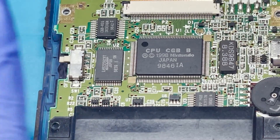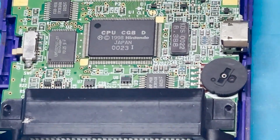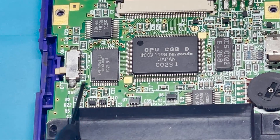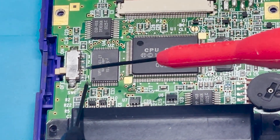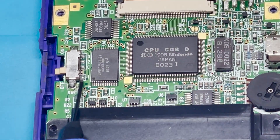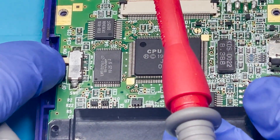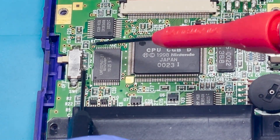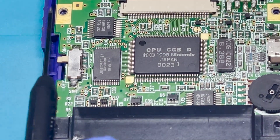Just to show you what it would look like on a working board, let me go ahead and get the other one. This one's in the off position — we're going to do the same thing: one and C. And that's working. Now let's turn it to the on position and test C and three. You can see that that's working.